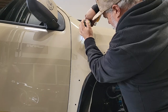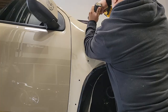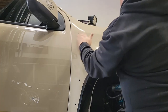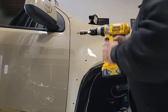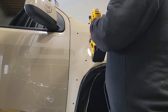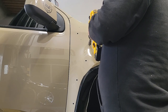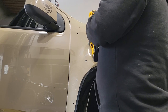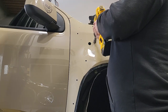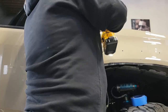With that all set, check how those punches came through and immediately start with some pilot holes. I like to start with a smaller hole to get all the way through before going to the three-eighths, which will be the top and the bottom — those get to the actual bolt size we need. Then I'll go ahead and use my seven-eighths-inch hole saw and cut those six primary holes. Once through the pilot hole, don't put too much pressure or speed — you don't want to bend that fender. Let the cutting tool do its work.